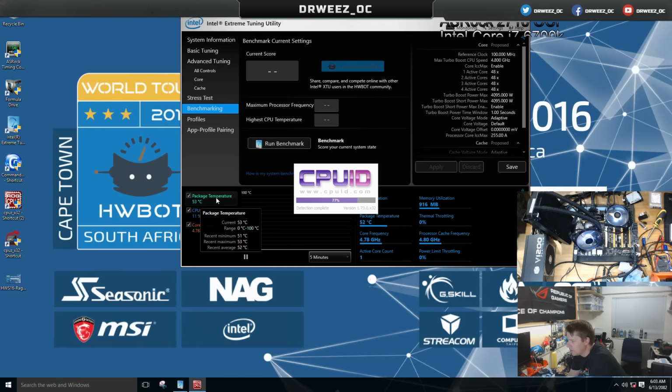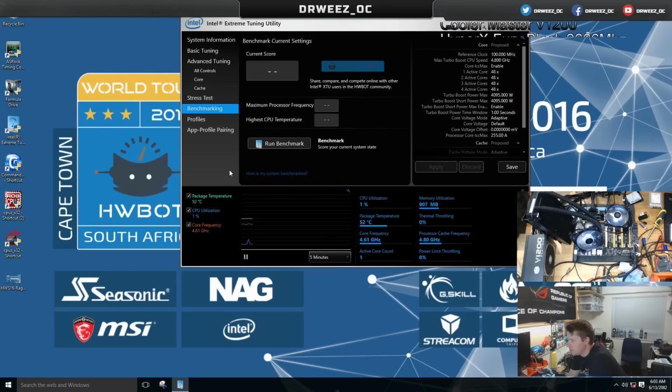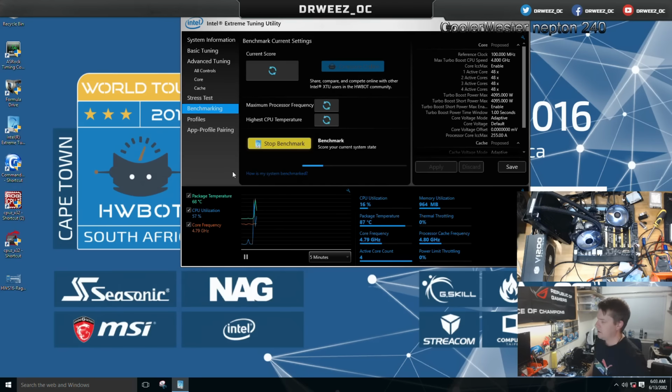Try again. So what you didn't see there in the BIOS is I just changed the DDR voltage from 1.75 to 1.68. So my basic fault finding method there was to increase the voltages to see if it made a difference, and when it didn't make a difference, I then decreased the voltages to see if it makes a difference. So to try and find the sort of happy medium in between.